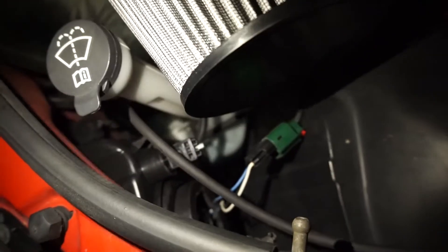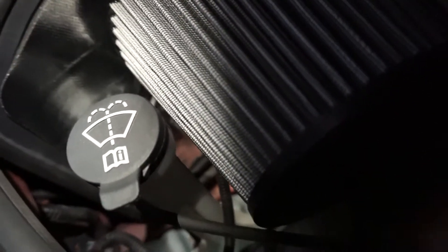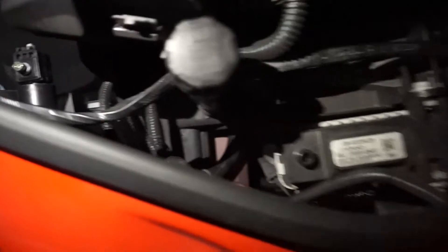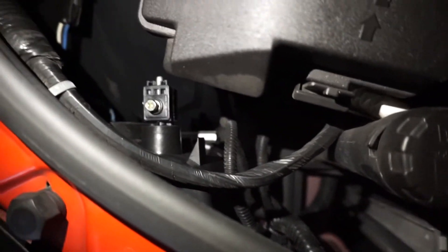You want it to be at that line or slightly below it. So I'm going to turn both of them up just a little bit to get it slightly below the tape while making sure that the left side is lower. Your projector should have something like this — a little screw right here. Mine: right is up and left is down. It's just a Phillips screwdriver. I can only speak for my projector, but I'm sure most of them will be similar. That's where you would adjust the beam — just sliding up.